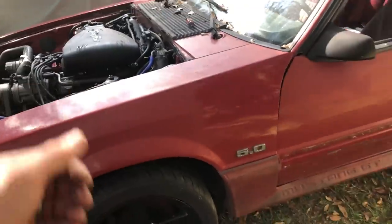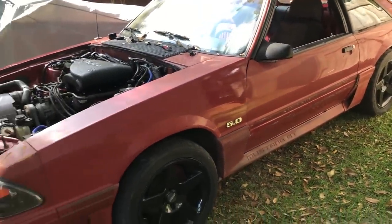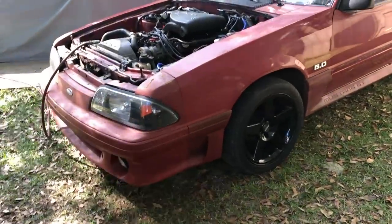The car has too big of a head on it — the heads are way too big for a B-cam. The intake is way too much for a stock bottom-end car with no gear. I'm sure it's probably 3.08s at best, and it's also an automatic transmission that is not wanting to work properly. You can imagine this car is going to be a hell of a lot quicker once we get the bugs worked out. Vacuum leaks and all — the way the car drives, I'm actually really impressed. It's not all over the place, it's pretty solid on the road, and the brakes feel pretty good.